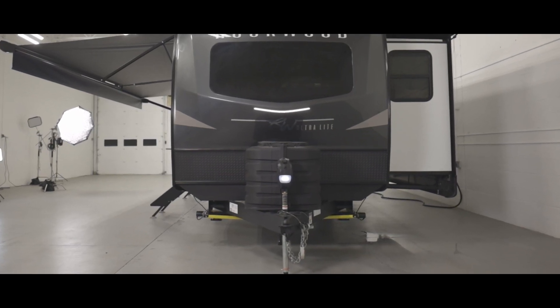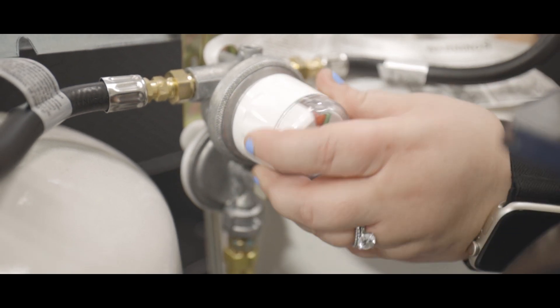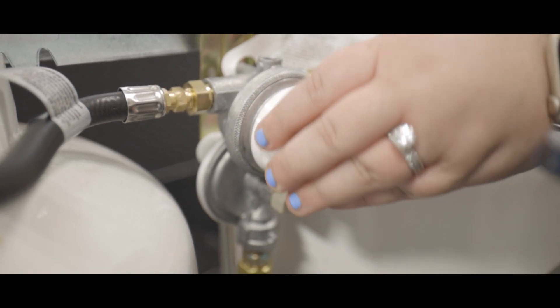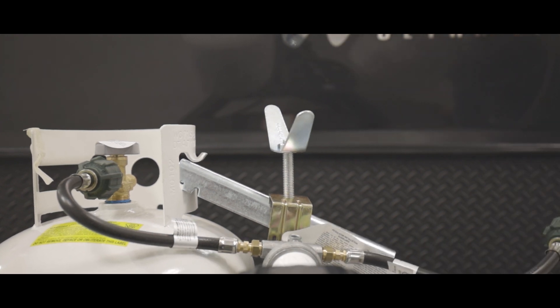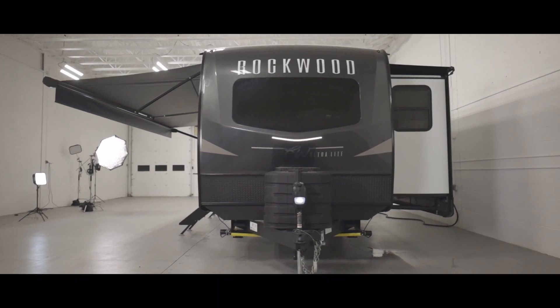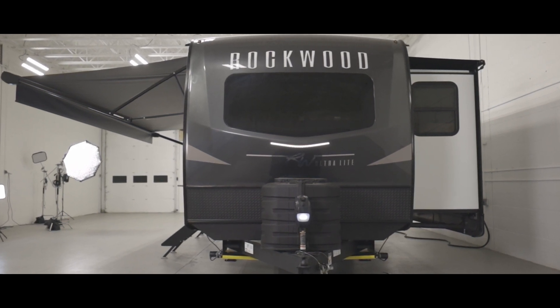On the very front of the trailer we have the tongue jack, battery disconnect switch, LP tanks, and LP tank regulator. The LP regulator has a changeover lever on top to control which LP tank is primary and secondary. The regulator has an indicator that will turn red once the primary tank is empty, and will automatically switch to pull gas from the secondary tank. When removing the LP tank to have it filled, change the regulator over so that the empty tank is set as the secondary tank so you can remove it safely without losing your LP supply. The battery disconnect switch should be on when you are using the RV, but when storing the RV we recommend switching it off — this disconnects power from the main RV to your battery so it isn't drained while not in use. It does not cut power from the RV solar system, so solar can still charge and maintain your battery while the RV is being stored.